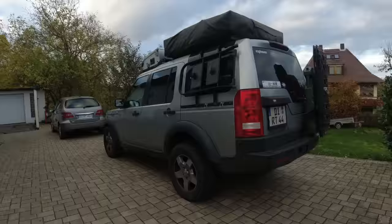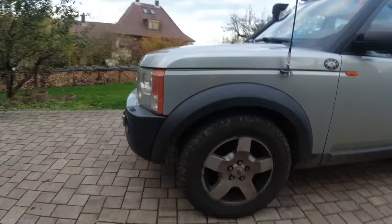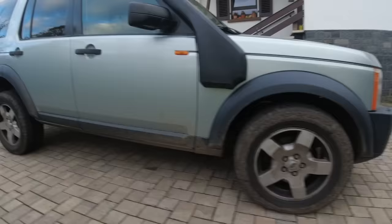It's now just about four hours later. Look how high it is in the rear and look how much it dropped on the front left side. We apparently have a leak. The other side is also down a little bit just because the front left side is, but the leak doesn't appear to be there. On the other side it looks just fine.